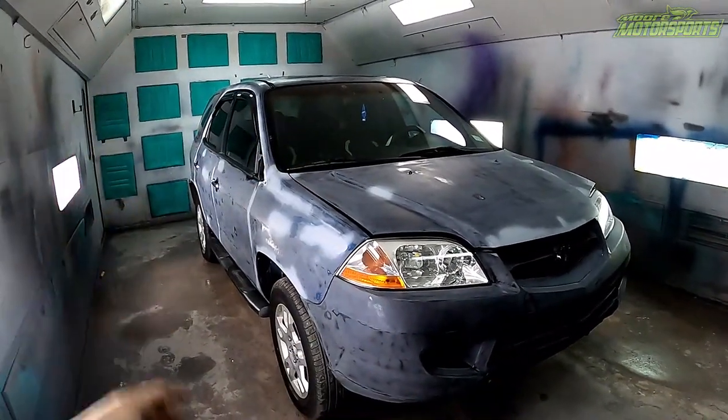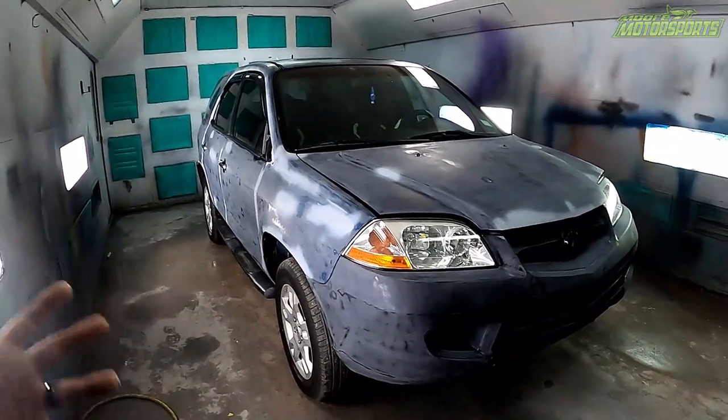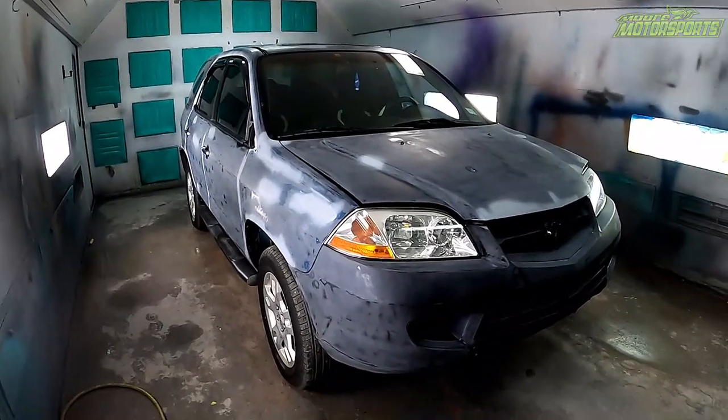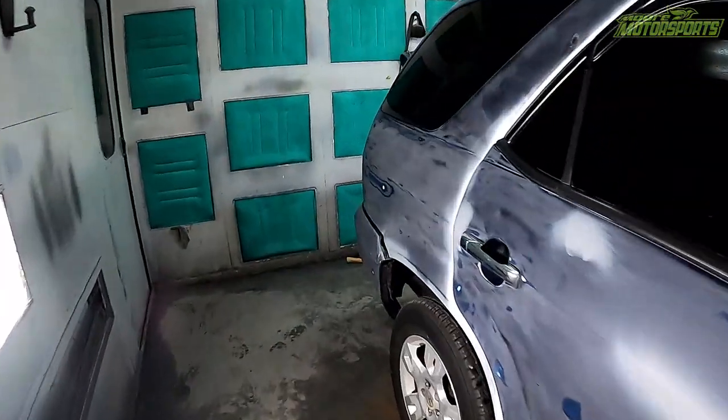We're going to lay down a white base coat with spray paint. It works really well in my experience and doesn't have chipping issues. We lay the white base and then we can go over it with the white bed liner with the glow-in-the-dark pigment. But I'm going to go ahead and add the glow-in-the-dark pigment to the paint and we'll get it on the paint shaker. So let's go do that.